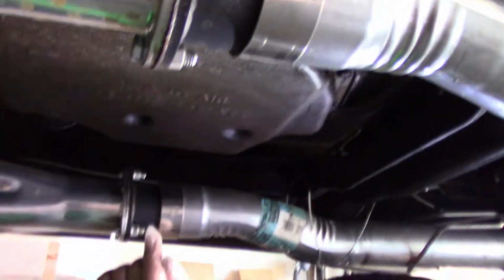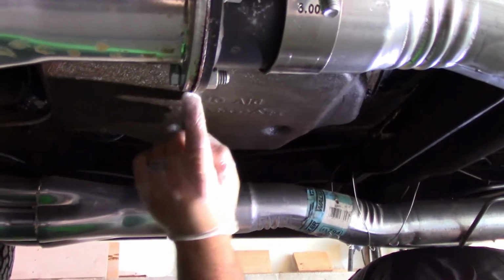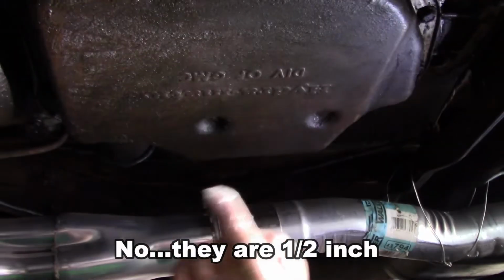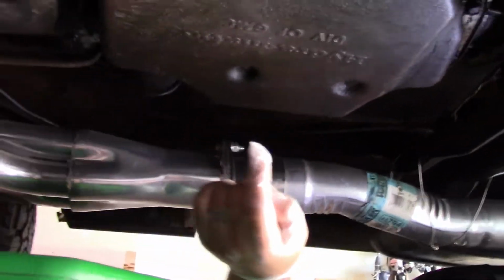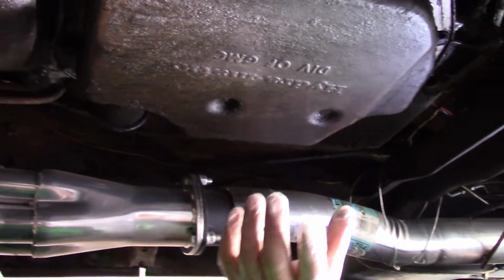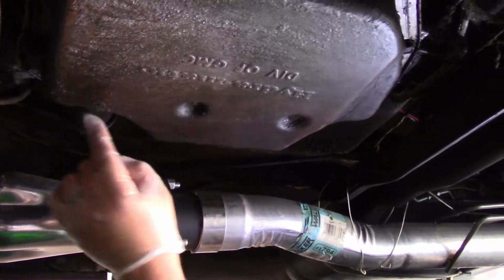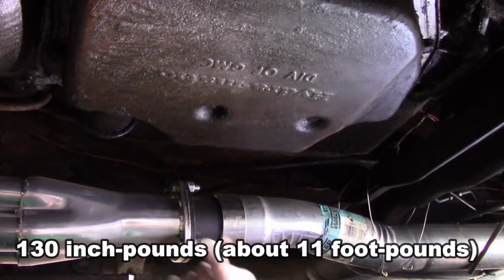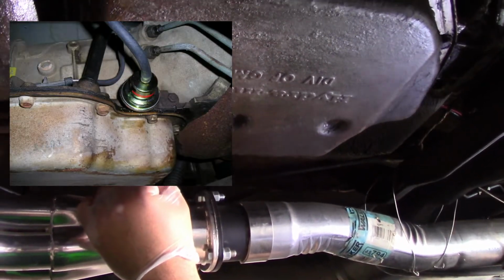Under this truck, like I said, it's a Turbo 400. This is your transmission pan. I believe these are 9/16 bolts. We're going to clean all that up, and then I'll clean this pan up once I get it off, and we'll put the new filter in, gasket on, and then there's a torque spec for these bolts. We'll look that up. I'm not sure off the top of my head right now, and then we'll change this transmission modulator valve out as well.